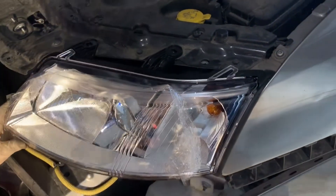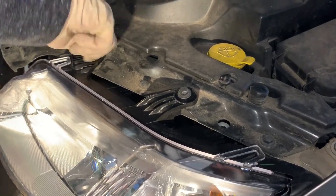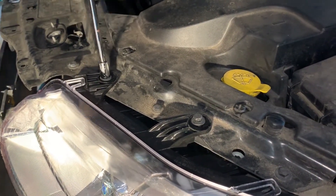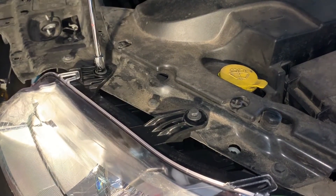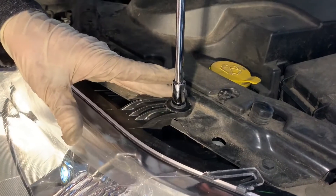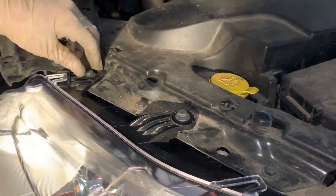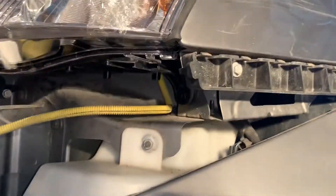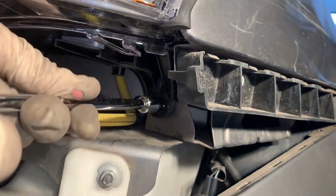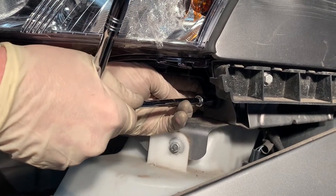Let's see — this is perfectly lined up here as well. Now that we've got it lined up, we'll just reattach it. We're going to do this by hand rather than with the power tool, because this is plastic and you don't want to break it — for example, on the other side it was broken, either from the factory or someone overtightened it. So we're going to put a bolt back in here at the bottom as well. Do not over tighten — this is plastic. That completes this side.